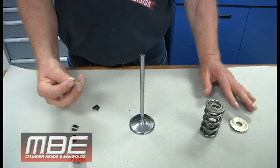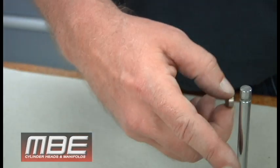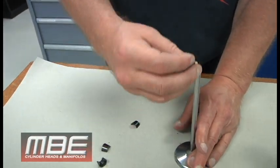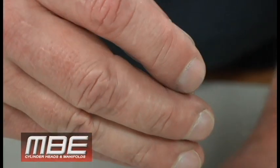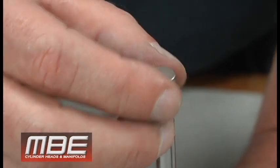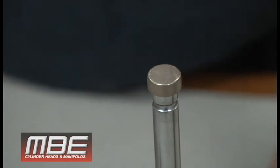The other thing is we don't run the black lash caps — we run tool steel. This is a 310 here for our 516 valves; we run 310 and 311 on the 516 — 311 thousandths and 310 thousandths. We want this to fit tight. A 310 cap on a 310 valve — you can almost hear how tight it is as it goes on, it actually has suction. The reason we want this tight is so there's no movement back and forth, it doesn't wear the tip of the valve out, and it's less energy on the valve tip.